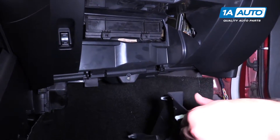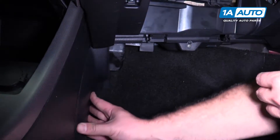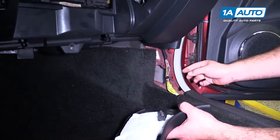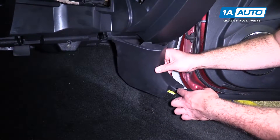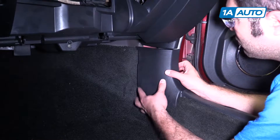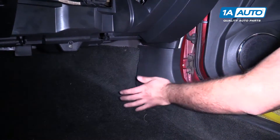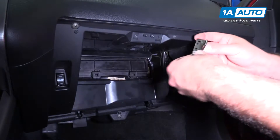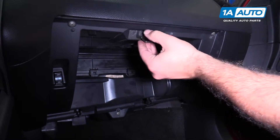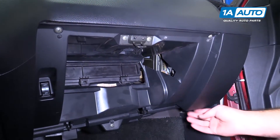Before I get too far, I'm gonna install this trim panel back. Push this in. Reinstall this trim panel — it needs to go underneath this and into this little channel here, so it's best to lift it up like that and push it down. Finally, install the glove box lock bracket — it just sits on those little tabs and holds it in place. And there's one final screw; don't forget it's under here.